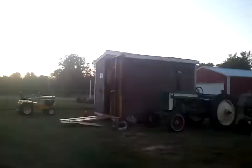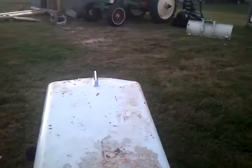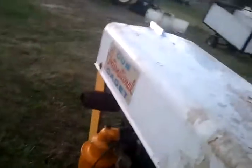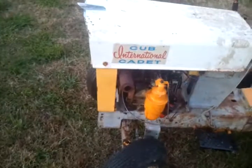Here is the M16 Freak. It's about dark outside — the sun is barely popping over the trees. And here's the original. Like I said, I got it out. I got a float put in it. I'm going to have to adjust on the governor and throttle linkage. It ain't working right. It's set there and run, but it still needs some tweaking to it.